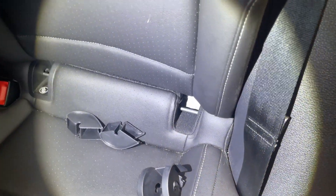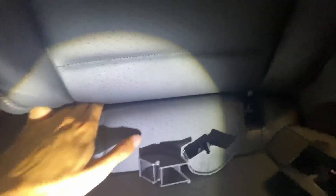I got the first one out. What I would recommend doing is folding down the seat a little bit, because that will give you more room to stick your fingers up above this thing, reach back here and pull it out, roll it up a little bit, and then this thing should just pop right out. I'm going to continue this step for the other side of the seat, and then we should be able to just pull this entire bench up.